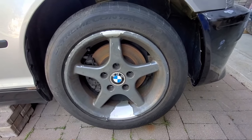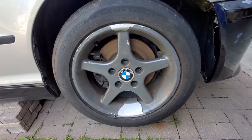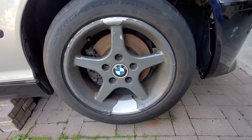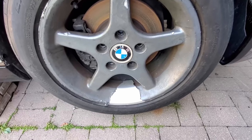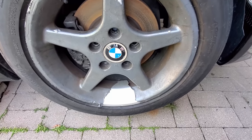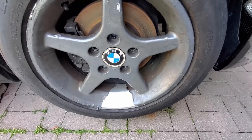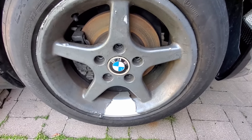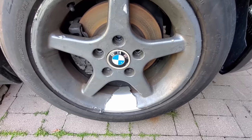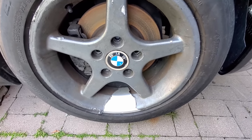When I purchased this BMW several months ago, I noticed right away that the wheels were painted with a vinyl paint, which most people know as PlastiDip or AutoDip. Upon further inspection, I noticed they had not been painted very well. This video is about how to properly paint aluminum wheels with vinyl paint. I started peeling off the paint and noticed it wasn't coming off very easily, and there are two reasons for that. The first reason is applying vinyl paint to a non-clear-coated surface, which inhibits the ability for it to peel off in one piece or in several large pieces.